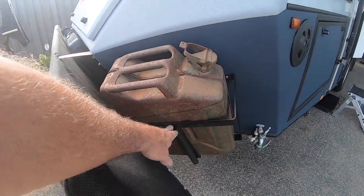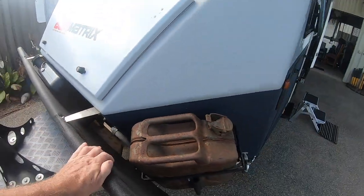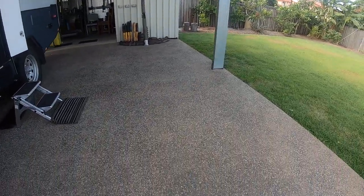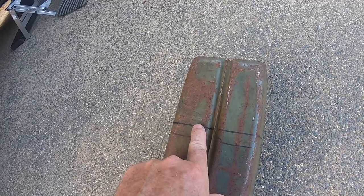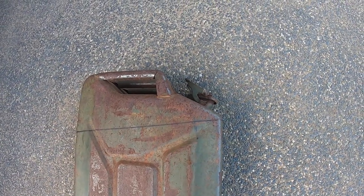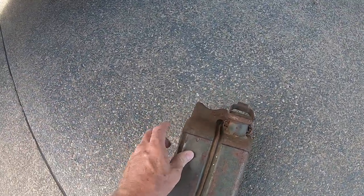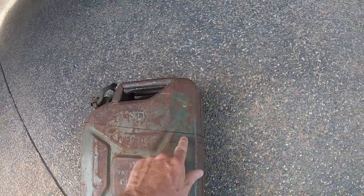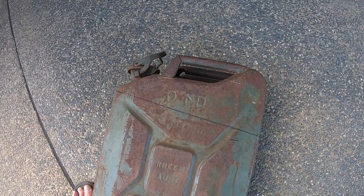I started off with the jerry can in the front on the jerry can holder and marked a couple of lines, particularly around the back here at the lower point. You'll see lines already there - those are the original lines for the bracket, they've come up a little bit. I picked a spot below this corner, about a centimeter, drew a line across at a right angle, carried it across and cut it with an angle grinder.